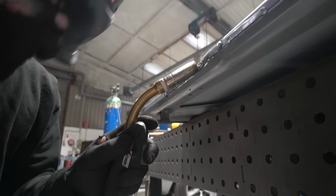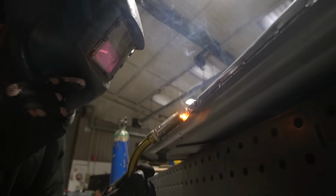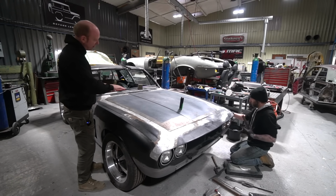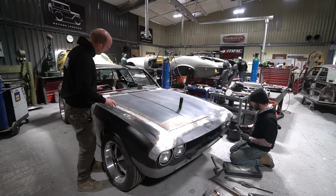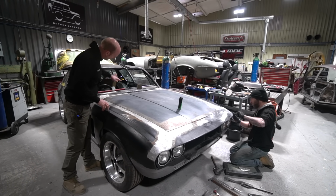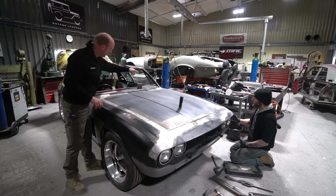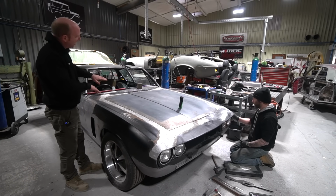was got. That new skin then needed a fair bit of reprofiling, which Matt spent quite a bit of time on, which we've touched on before, but basically just getting the edge profile to follow the same lines as the car. The curvature that way was incorrect, and the curvature that way was more of a W. The bonnet dived down at this swage line, went up in the middle, and then dived down at that swage line. So it's a W profile across the back.